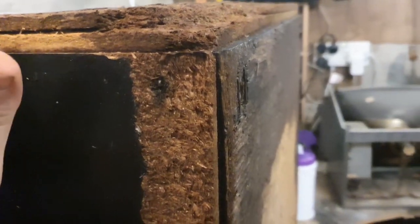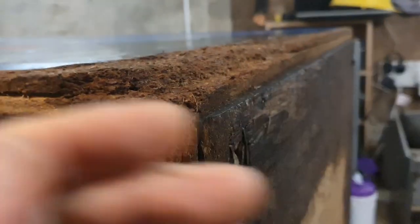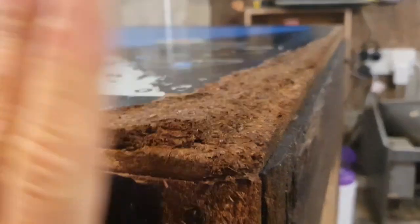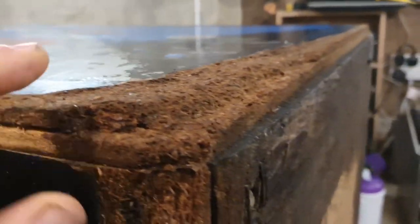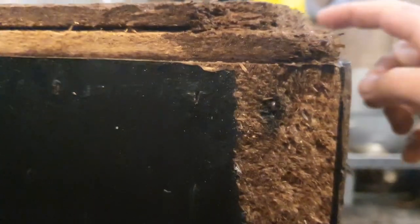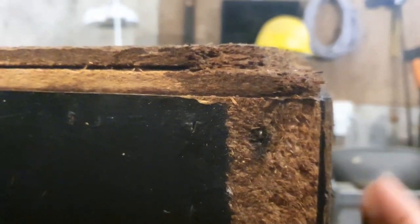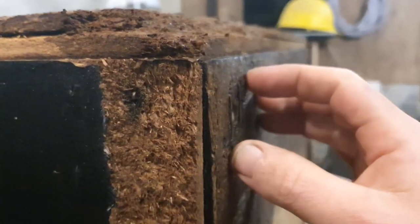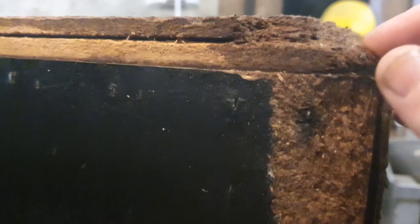I'm not going to use the standard Bondo type stuff that you see. I'm going to use some fiber mix, Isopon mix, which is used for boats and a lot of more structural repairs. Also, I want to strengthen this corner here because the T-molding will come here and this will be a corner. I'm not sure exactly, although I put wheel casters here. But just in case, because it's a bottom corner like that,